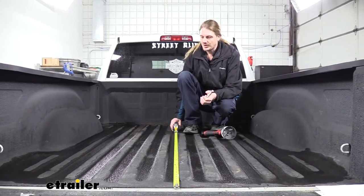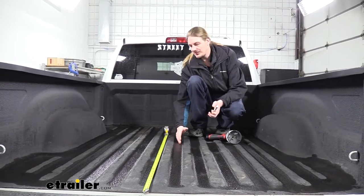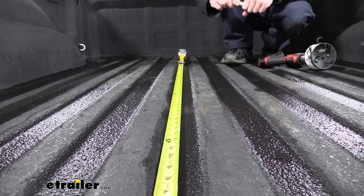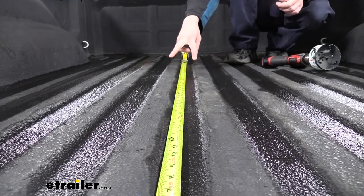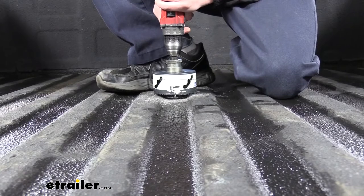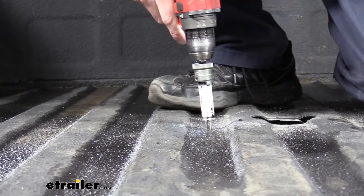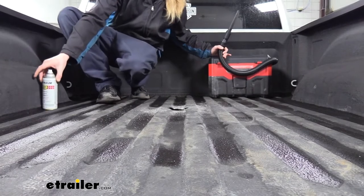Once we've got that in place, we're going to hop over one corrugation section — that's about four and three-quarters of an inch over. Refer to your instructions again because there's a different measurement depending on whether you have a short or long bed truck, and you'll make your mark at this location as well. This second mark is non-traditional — due to the way the fender liners are on this truck, there's no side release handle. Instead, it's going to be an in-bed release mechanism, and we do have to cut out a small hole to be able to use it. Now we'll take our hole saw, starting with the larger four-inch hole and drilling it out, then moving on to the three-quarter-inch hole saw for the second hole. We'll clean up and apply some clear coat to seal it up and protect against rust and corrosion.